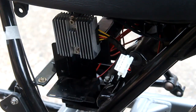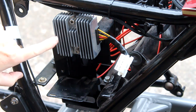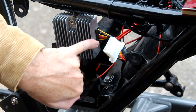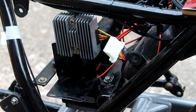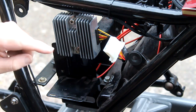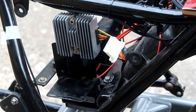So that's all the theory of the charging system — now let's move on to the practice. Here we have a bike for which I'm building its wiring harness, and here is its rectifier bolted behind a side panel. It's got a multi-pin plug to take the power in and out, with three yellow wires from the alternator, plus a black wire and a red wire. The red wire is power to the battery and the black wire goes from the battery back to the rectifier.